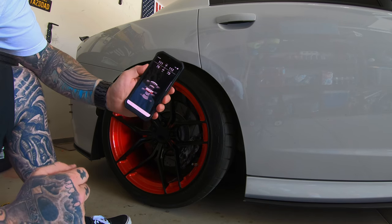I just love the way she looks all aired out. I hope you guys found this video useful. Again, this is on my Dodge Charger Scat Pack but the principles stay true to all digital management systems. Maybe you have AccuAir and can't get hold of the shop that installed it — the concept is the same. Make sure you're measuring each corner with a tape measure, set your presets accordingly, and you're good to go. Share this video with a friend if they're on air, or come back to it if your system wigs out. Leave a comment if there's another topic you want me to cover. As always, be unique, stay humble, and God bless.